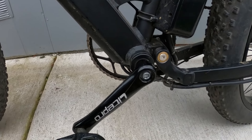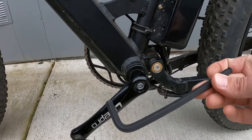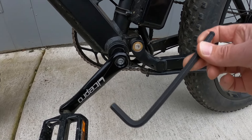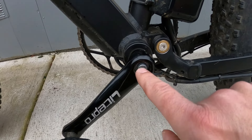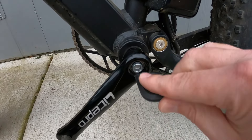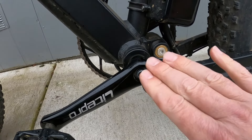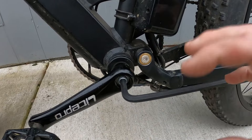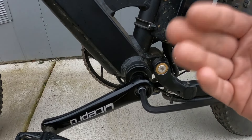So double check both sides of your bolts — they're going to be a little bit loose. Even the right side was just slightly loose, so I tightened it up with this Allen. Remember it's an eight millimeter size — it took me a while to find out exactly what size this was. I'll leave a link in the description for the replacement bolts that come with this shroud, this piece of plastic that keeps dirt and debris from going inside and rusting that bolt out. Eight millimeters is the size you want. Crank that down as tight as you possibly can — don't bend the Allen bar and you don't want to strip it, but it can take a lot of pressure. It's a heavy duty steel bolt. Make sure you get that nice and tight on both sides, otherwise it'll loosen up over time and you'll have issues.